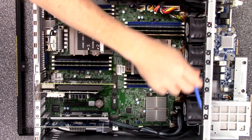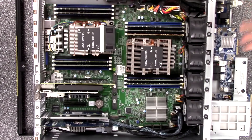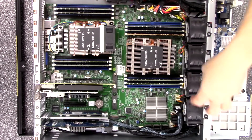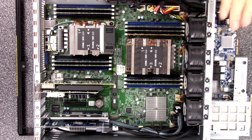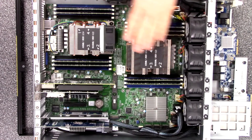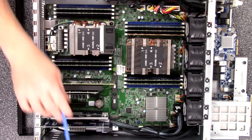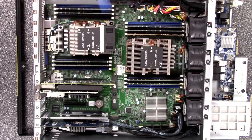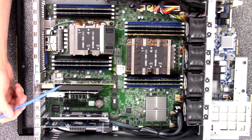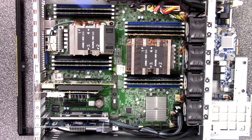Let's take a look overhead at the motherboard. We have dual Xeons right here. The fans are removable — on nice little rubber dampers, they just slide up carefully. They're not drop-in socketed ones, but you're not replacing them that often. That provides cooling for the first processor; the second processor further back has its own dedicated fan. You can see all the drive connectors and controller cards, the extra expanders, and how they route back up to those edge connectors in the front. With the QSFP card we have 40 gigs of connectivity, and you can put different cards in depending on your needs.